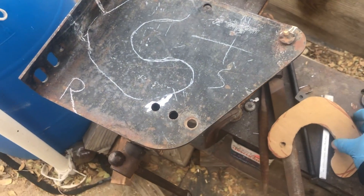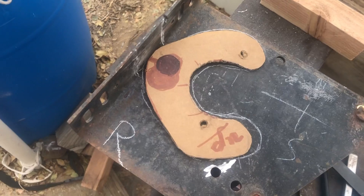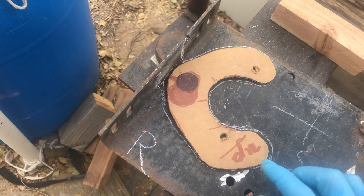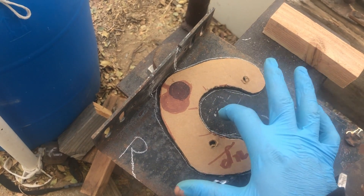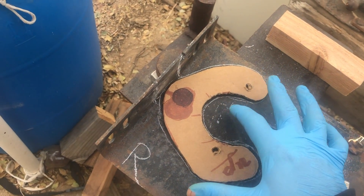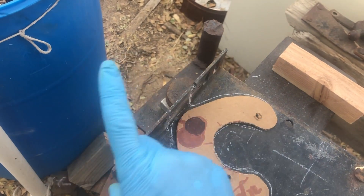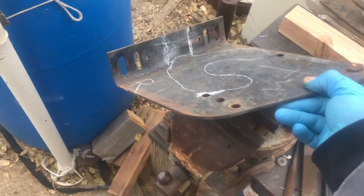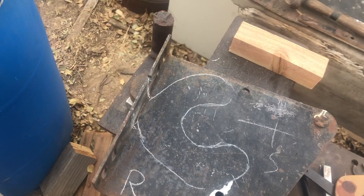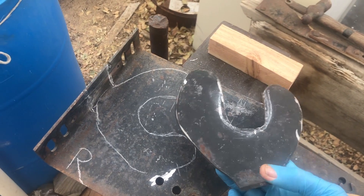Yesterday was really just creating this design here. What we ended up going with was cardboard of course. These are our two bolts, here's our center bit — that's the shock strut tower that connects to your actual shock itself, bolt top. That is essentially where we're going to connect our bar up to our next bar. That's the top one, right — angle. So what we had was this thick, light steel. It's actually working out pretty good.